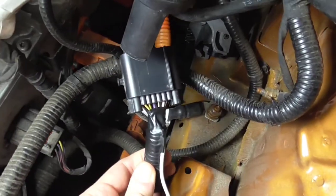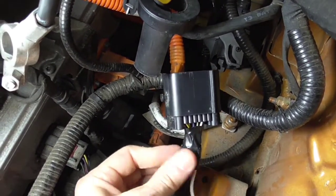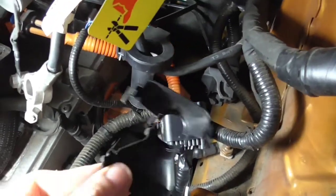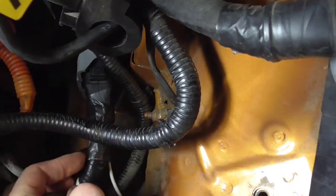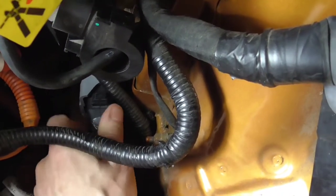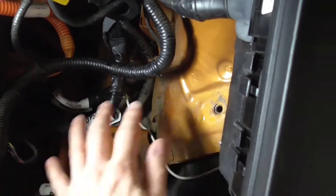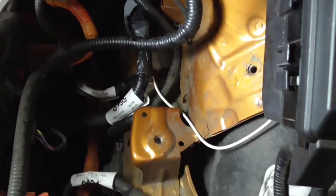Here's what it looks like in a more finished state — I wrapped everything with electrical tape to bind it together with the other wires and keep it from moving, and wrapped it around the base to keep it tight. Then put the little finished piece back on. When I put the outer cap back on, it didn't quite close on the wire side, so I just wrapped it with some duct tape to keep it in place and sealed. It went right in with no resistance. We have some extra wire here that you can route — the battery tray will cover most of it, and the only visible wiring is up top, which is basically unavoidable but should look pretty much factory.